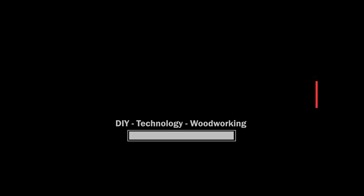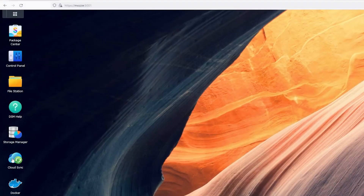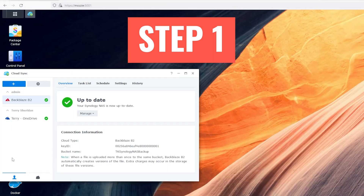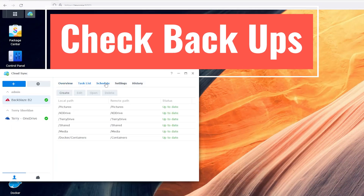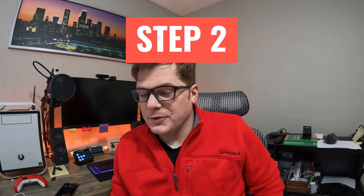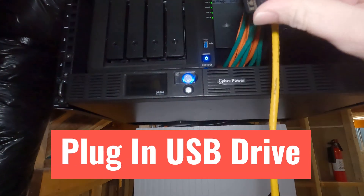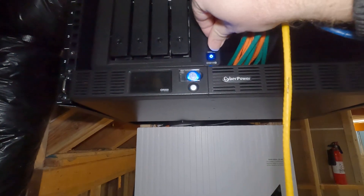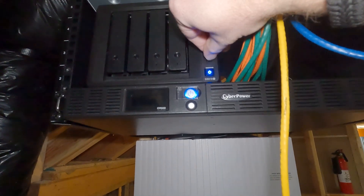I'm logged into my Synology. Step two: insert your flash drive. You can create a system partition to store the keys, but I prefer — and Synology recommends — using a hardware USB key over a system partition because it's more secure.